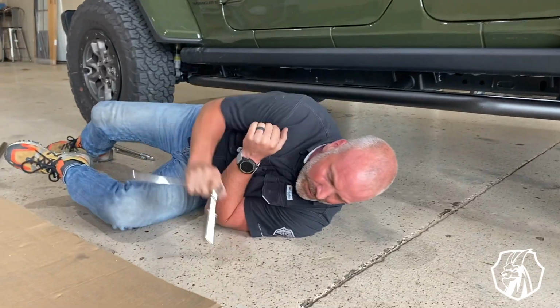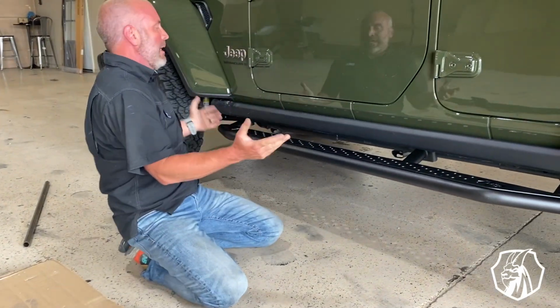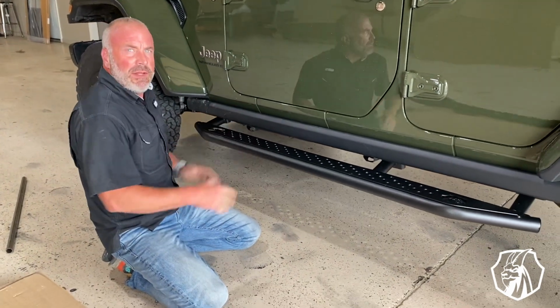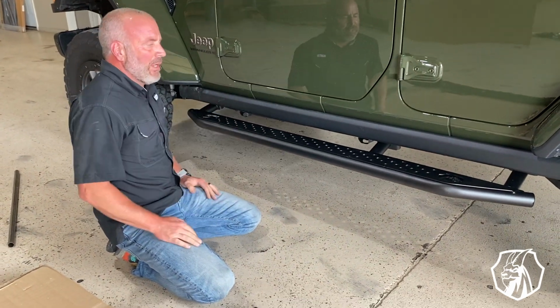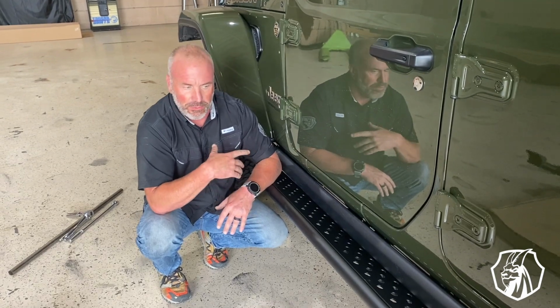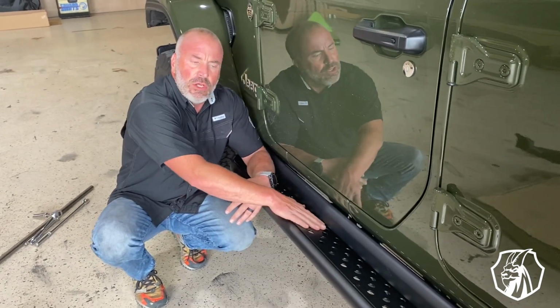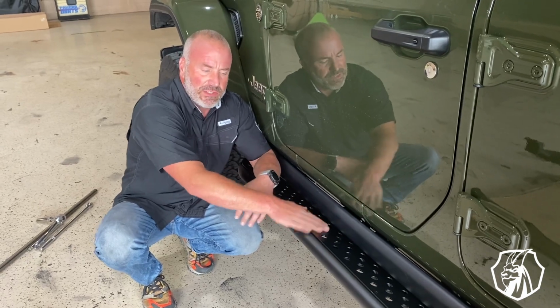Okay, well, at least we got everything started. Now we can work our way up, tighten each bolt, move end to end to the center until we draw everything up, and like I said, then start to torque everything in. All right, now we've got it installed. Bolts are back in. We torqued everything to the 80 to 85 foot-pounds of torque in the 3 locations. As you can see, the rock slider is mounted, and this is where it gives us that 23-degree of slant on the side of the vehicle.